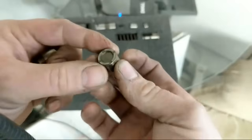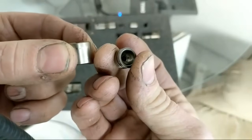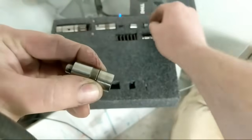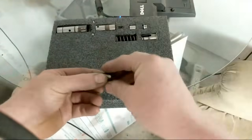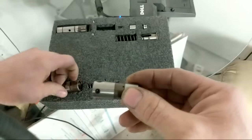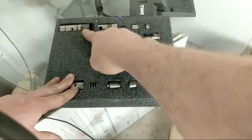If you look right here, you have the same style channel. The slight difference is this bump — the only reason the bump is in this one is because it's just not tall enough for the push rod to seat into properly. The larger version is nice and tall with a lot of room, so they didn't need to do that. You can also see this oil passage here is much, much bigger than the oil passage in the smaller one. That oil passage lines up with the lifter shell, and the oil area accommodates the movement in and out. Essentially it's a stock-style lifter inside of a stock-style lifter — just a small version.